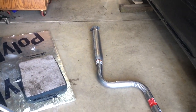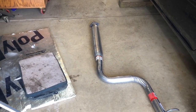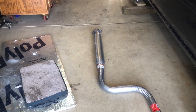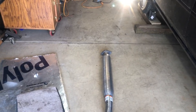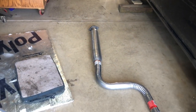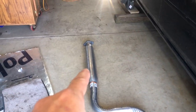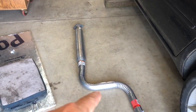The reason for this is that everything under here is welded, and without a welder and the ability to cut things off and weld them back, I had to make it a slip joint so I could use clamps. The nearest thing that had bolts on it was the end of the resonator where it meets up with the catalytic converter pipe, which is okay because it's all rusty under there and these aren't that expensive. The resonator was $39 and the intermediate pipe was $52.55 with free shipping from AutoZone.